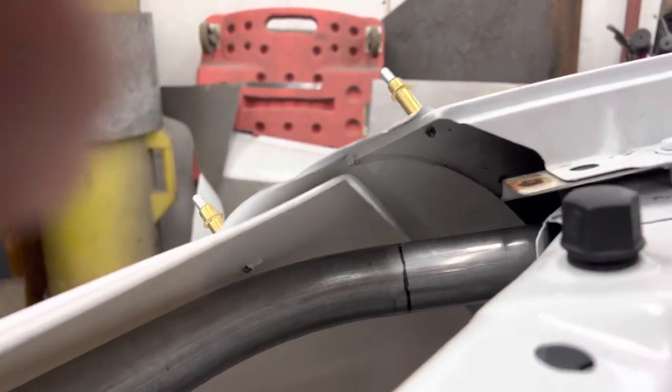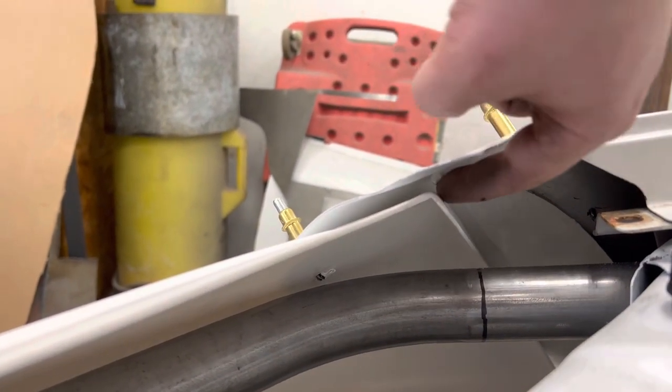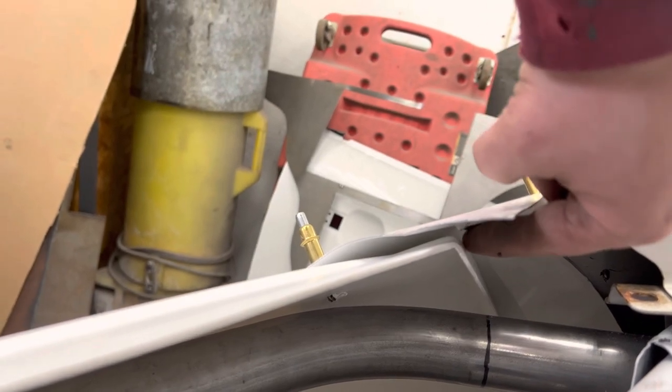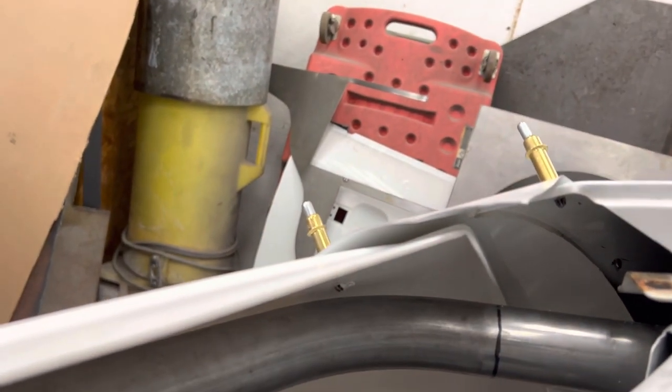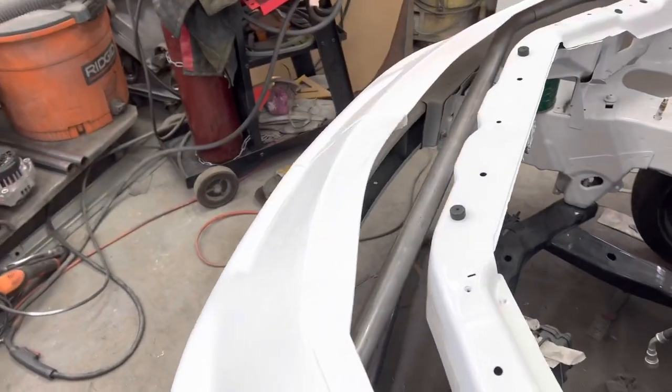See it in there? And this one's actually bent down a little. It's got a kink in it. I probably leaned on it or something. But that molded edge there, that molded bump, is 1/8 to 1/4 just outside that. That's how you get it centered. That bend is not helping anything, but that's all right. That's how you do it. So now I'll get my arm in the way. Now I'll pull that bar forward and get that stuff all welded up.